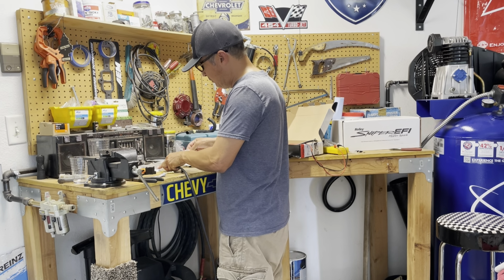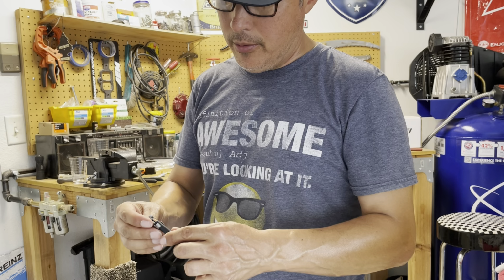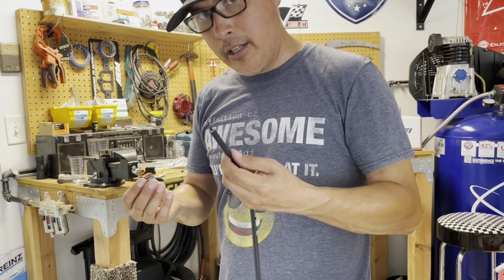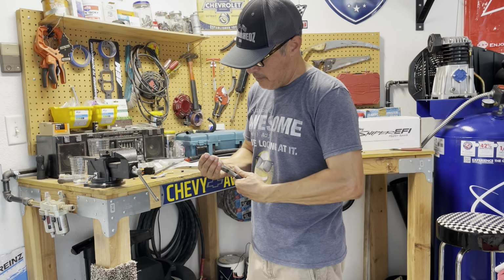And then this is going to fit right in there. It's going to saddle right in there. So you see. But the instructions say that you need to bend these 90 degrees before you get that done. So what you're going to want to do, according to the instructions, is put this in and then crimp it down before you fasten the conductor down on this section. So I'm going to get some wire cutters here. I'm just going to bend this a little bit. Let's do a little 90. And you'll see why in a minute.